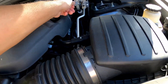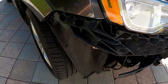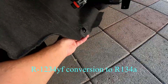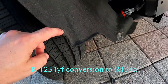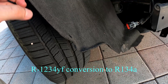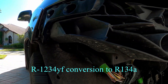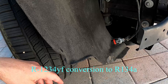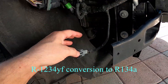You don't need to do anything here. Once you put everything back, just make sure you don't break these little tabs on the inner tire well like I did. Unclip this piece from the bottom — right here. When you take this out, as I showed before, there's a little silver clip on the inner. Unclip that and this piece comes out — give it a little push down, it unclips from up here, and then you can take out the bumper a lot easier. I was fussing last time and didn't realize I didn't even need to break these — that's why they have them riveted on there with plastic. And obviously put all the lights back, all the connectors, and this connector here.